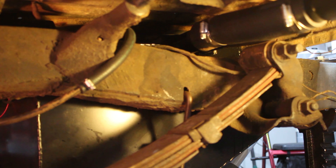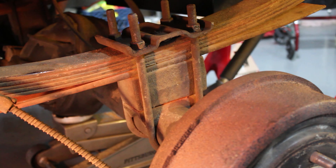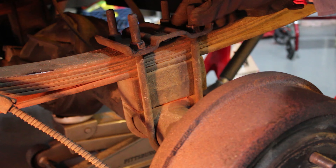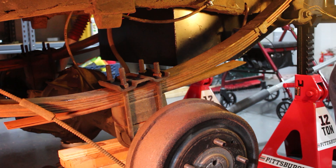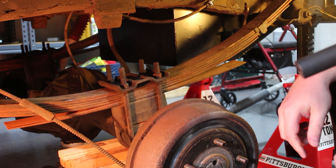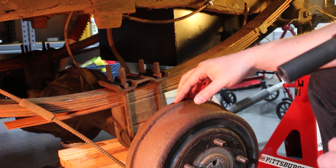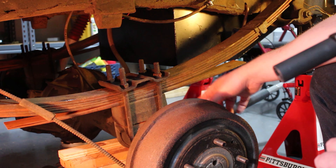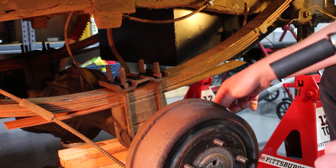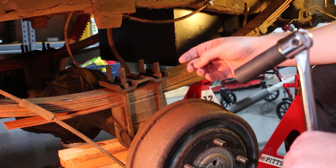It's only on one side so that came out pretty easy overall. More concerned about the U-bolts in this case because these are really, really bad off here. After thinking about it, I made a decision — I am not going to remove my e-brake cable. I really don't want to have to pop this off and disassemble the brake just to disconnect that cable. So I decided to prop the axle up so it won't fall over and put any more tension on it. I may have to actually cut the U-bolts because they're pretty nasty.